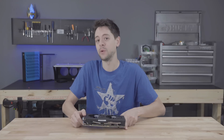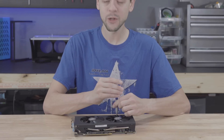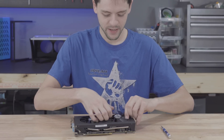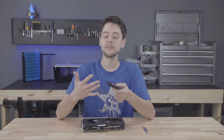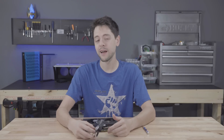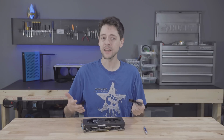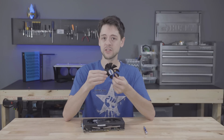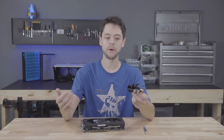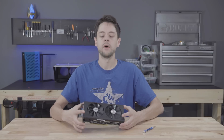It also has a couple of cool tricks up its sleeve. I have my screwdriver, I'm going to put it right here, twist it a little bit, take out that screw, and look at that — the fan pops right out. This is actually a pretty big deal. I know it looks like a gimmick, but people do replace their graphics cards because their fans fail. The heatsink on here already performs extremely well, and so do the fans, so I find it exciting that once these fans start to wear out — hopefully many years from now — I can just pop in a new set.